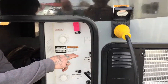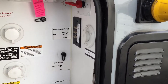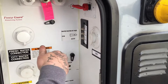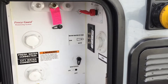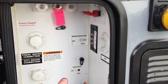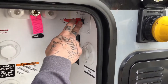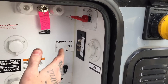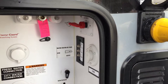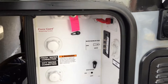Right here we've got satellite and cable prep. If you're at a park or have a tailgater package, you can plug a coax in here and it will disperse the satellite signal to all your coaxes in the coach instead of running it through the window or door. Then we have a battery disconnect switch — if you're going to be storing it and not using it, turn that off to eliminate any power drain off the battery so it's not low when you come back.